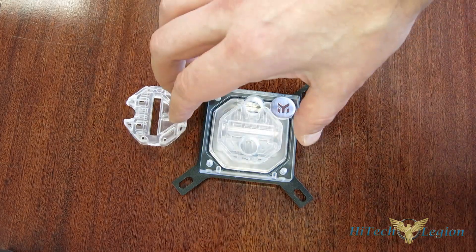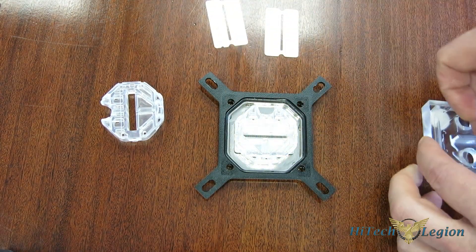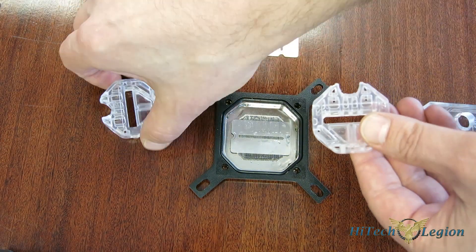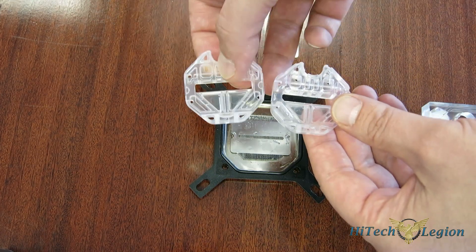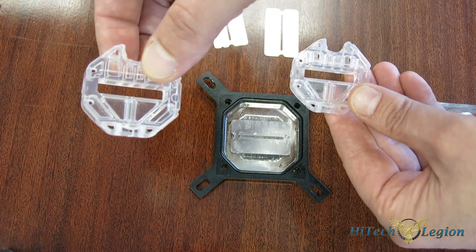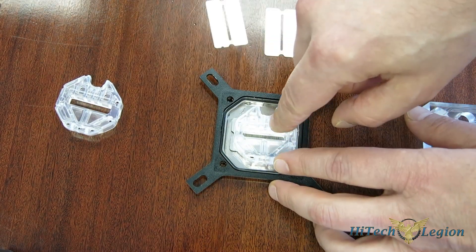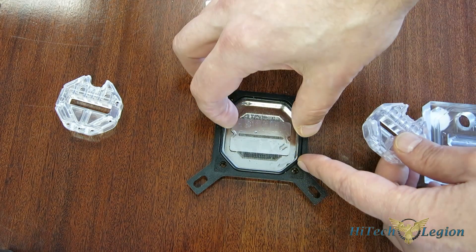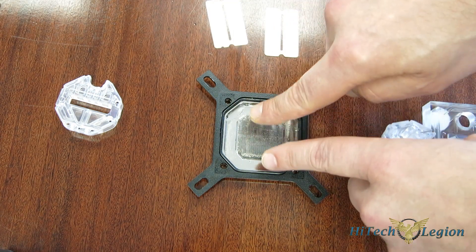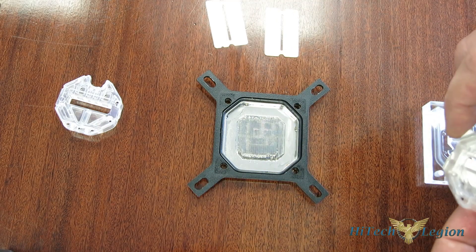I'm going to actually take it apart from the top. Popping the top off, your insert is right inside — that is insert 1. You can see, with a couple of drops of water still from testing, that insert 1 has a narrower opening than insert 2, which is used for AMD and physically larger Intel CPUs. Water comes down through the insert, is forced through the jet plate and through the micro channels from the center, so that the liquid is at the hottest point of the CPU, and then is spread out around the sides to come back to your reservoir through your loop. Really beautiful, interesting design.